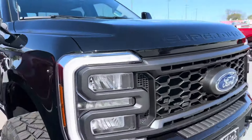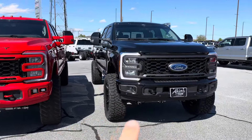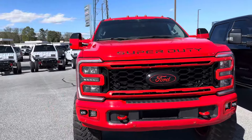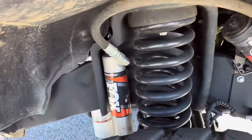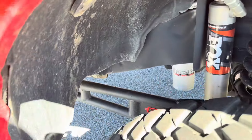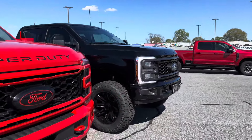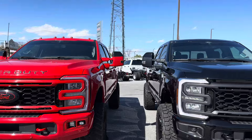I'm impressed with it so far, but this truck feels like it's driving taller than this one. Five-inch BDS Performance Elite shocks, non-coil over — coil spring shock with the resi, radius arm 3824 versus 3822 here. So this truck feels taller. Let's look side by side — we're seeing it live, just like I am.